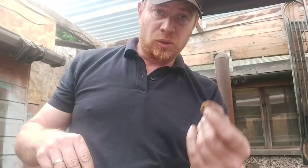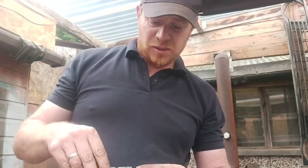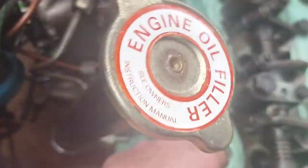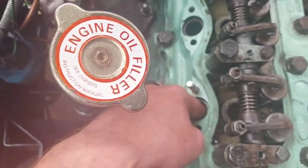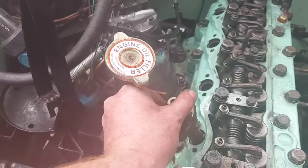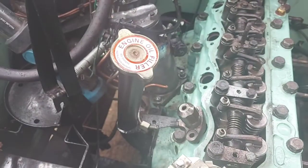But yeah, I'll get them, drop them down in the bores, make sure they're sat flush on the bottom, then slot the injectors in. So, right, I'll go and get them washers. Put the washer down, double check, make sure it seats. I can't get the camera in. Right down in the bottom, make sure it's sat flat. Then just slot your injector in. Make sure that's sat flush.